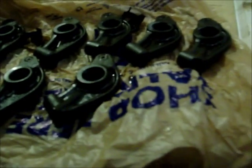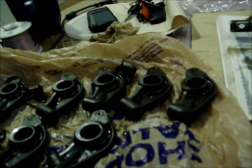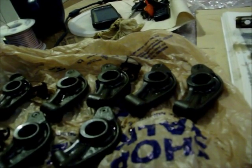I don't know what those stamps mean. They might be some kind of indication when the engine is being assembled - like it's just the bore, or maybe the way it fits together. I know there's some engine parts where each part is specifically designed to go in a certain place and you can't switch them around because the inside edge is a certain shape to make it fit just perfect. And just to note - these other lash adjusters do not flex at all, even though I've bled them out. They're not flexing. This one flexes, and this one actually flexes very slightly. So that's going to be causing your valve noise.